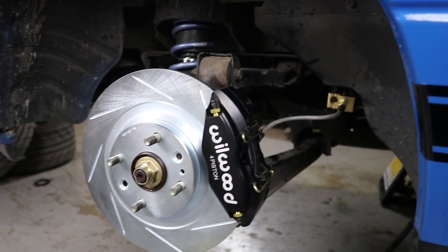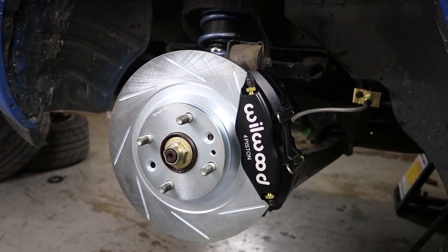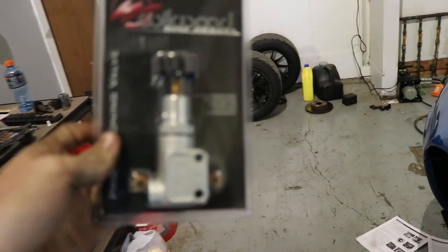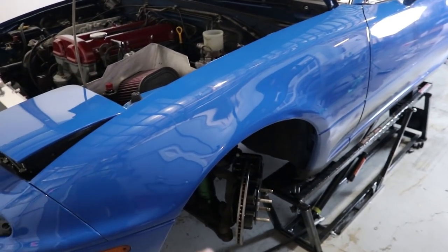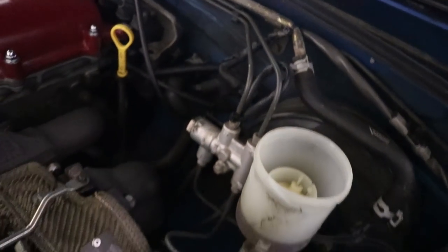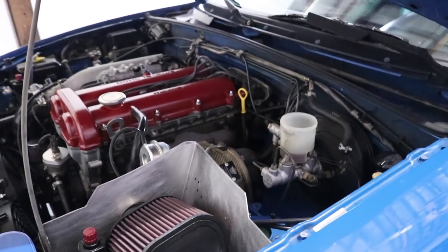The last side is complete. Now I thought we'd be done and ready to bleed the brakes, but we aren't quite there yet. We've got one more thing to install — this is a proportioning valve. It adjusts front-to-rear brake bias so we can make sure we fully get the full potential of these new brakes. This little guy replaces this thing right there. Probably gonna get brake fluid everywhere, but let's do it.